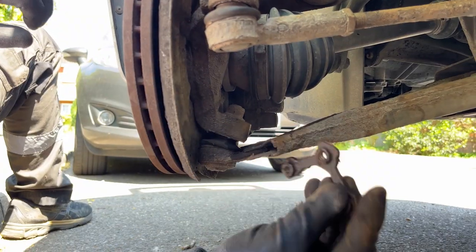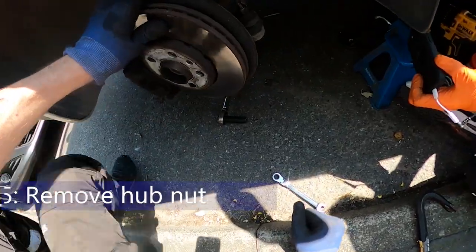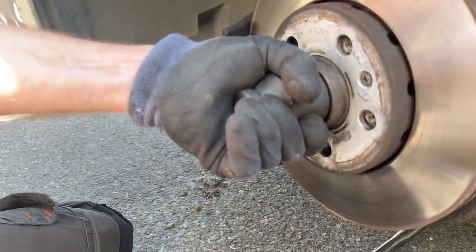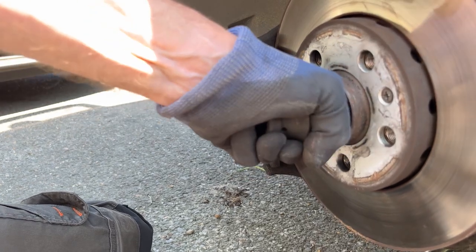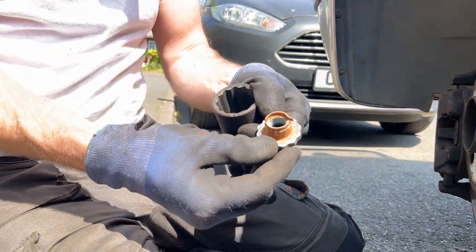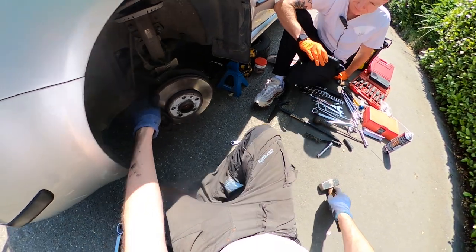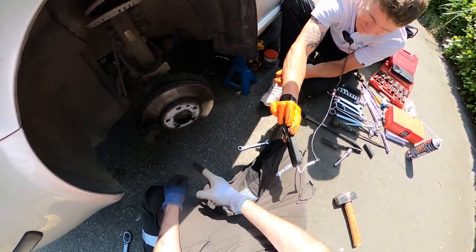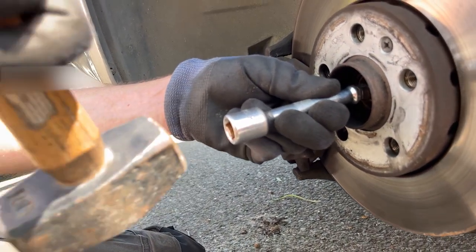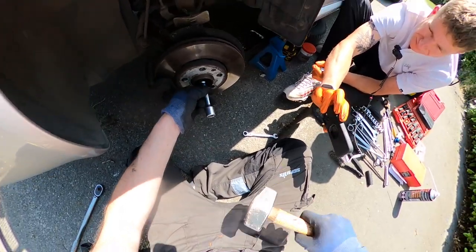All three bolts off. There's a retaining strap at the top with three captive nuts - that's all going to be replaced. We need to undo the hub nut in the center of the hub - I loosened it before I jacked the vehicle up. These tabs tend to break away, so you'll need a new one when you refit - I'll put the part number in the description. Now we need to disengage the spline shaft in the center of the hub and push it straight through. Best way is honestly with a hammer and a drift. Just be careful hammering onto these because you can ruin the head.